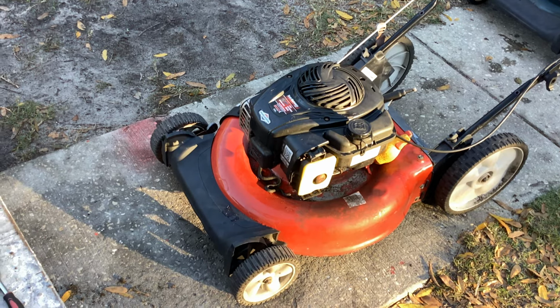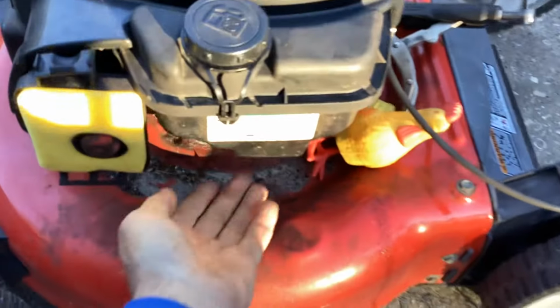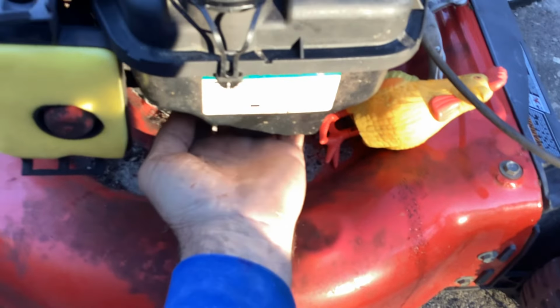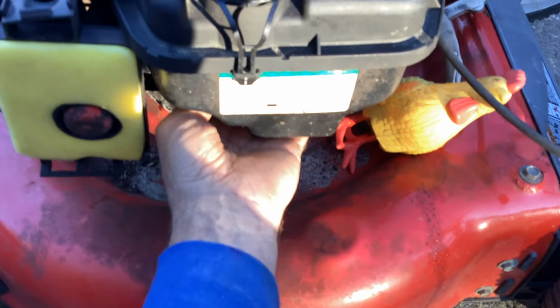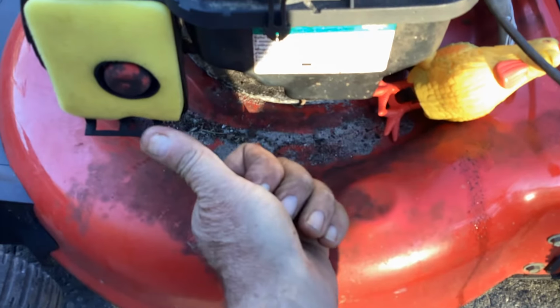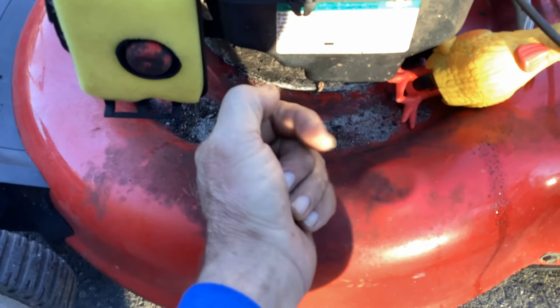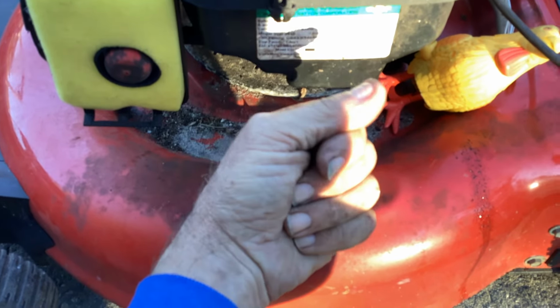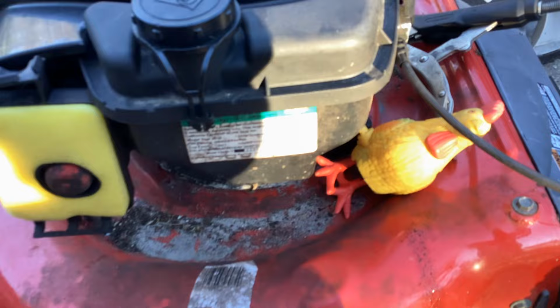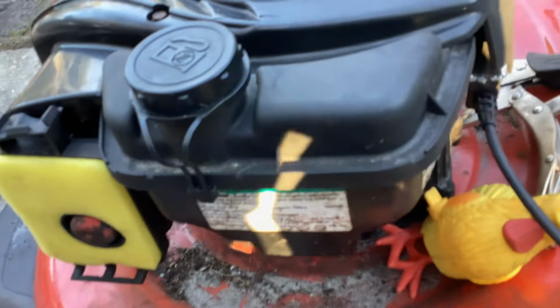Okay, quick adjustment on the RPM. It seemed like it was excessive. So I've got a video on how to adjust that. There's a metal tab attached to the spring under there. To the front is increased the RPM. To the back is decreased. So you take the top of the tab where the spring goes in and you push it either way, depending on what you want. So this is the model number 11 alpha